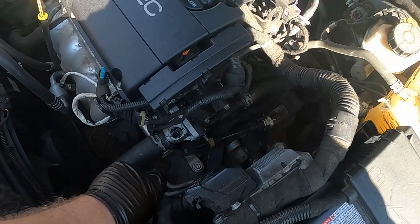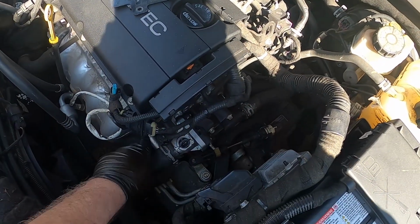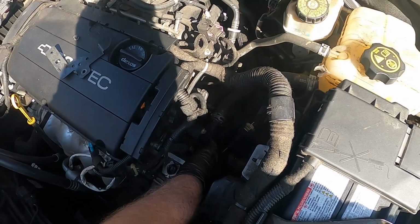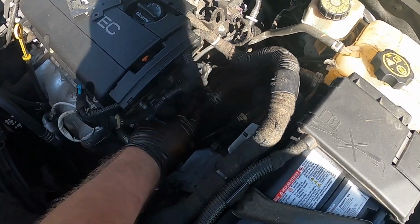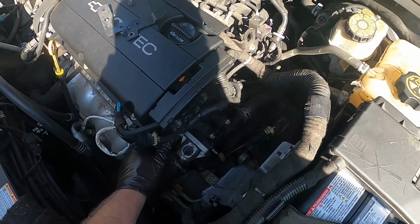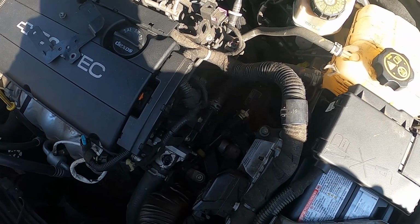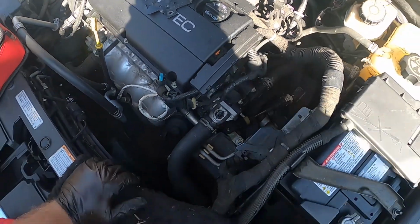So we're going to take hose clamp off, let the coolant drain, E10, and there's another one hidden right below here that you can't see right by the shifter cable. And then take this connector back here off for that coolant temperature sensor, and then the whole thing comes off. Easy peasy. While it's off, I'm also going to do the shifter bushing because it's going to make it easier with that being off right there.